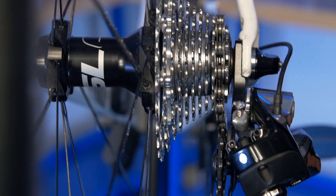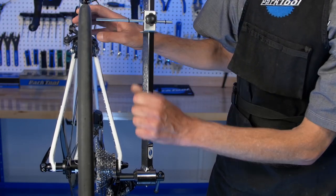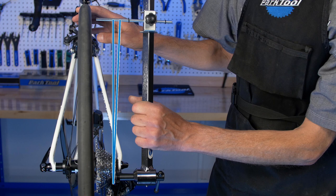Let's go back to our bent derailleur hanger. The first plane, or line, as seen here, is defined by the rear cogs, which is going to be the run of our tangent. The second line is defined by the guide pulley, and the rise of the tangent is this tiny line here. This is the error from perfectly parallel. It's very difficult to measure the rise or the deviation from the cogs themselves, which is why we need the DAG 2.2 to extend our run in order to measure the rise.